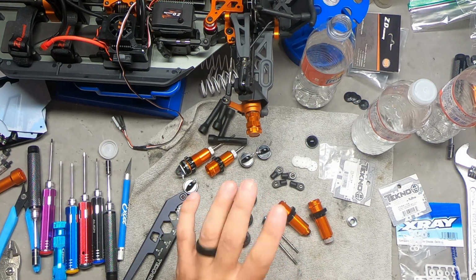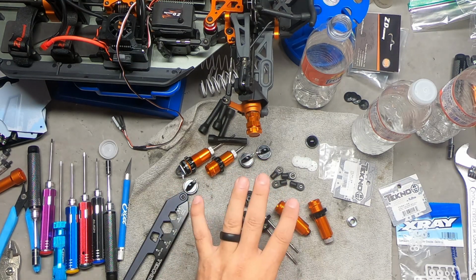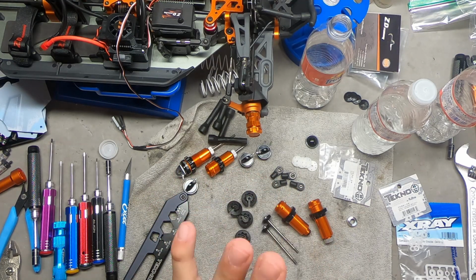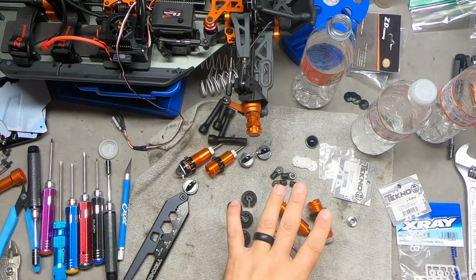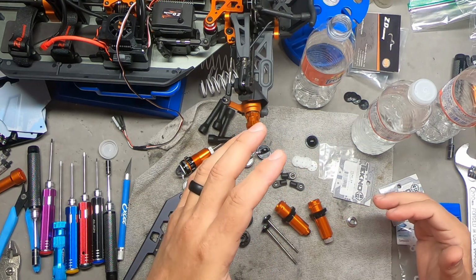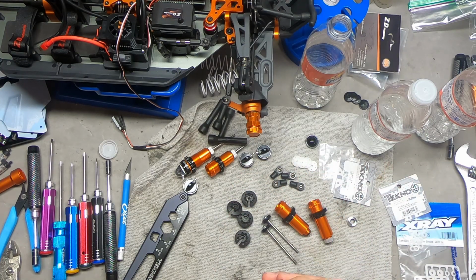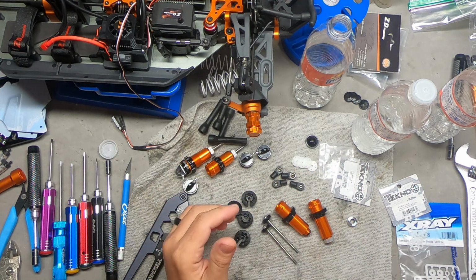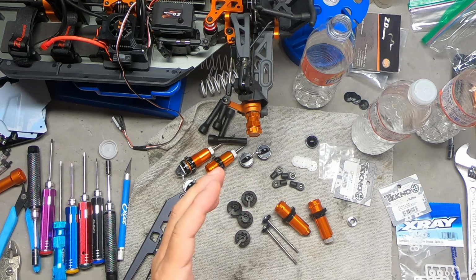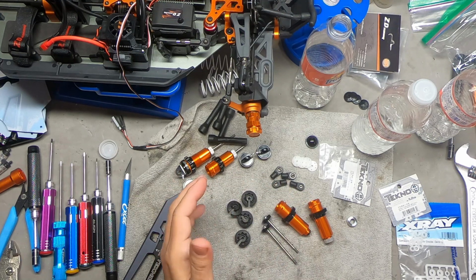If you've got a very bumpy track, you want less pack because you want the suspension to be able to undulate and manage the bumps. If you're on a smoother surface or you're hitting really big jumps, you want a little bit more pack. That way the shock isn't just bottoming out. You want it to ideally slow down before it bottoms out, and hopefully not completely bottom out. That's always a moving target because every jump you take is different depending on how fast you're going, how much height you get, et cetera.